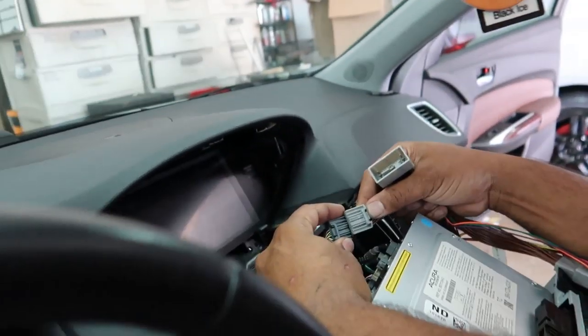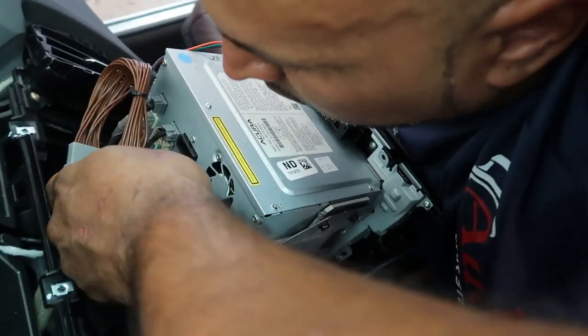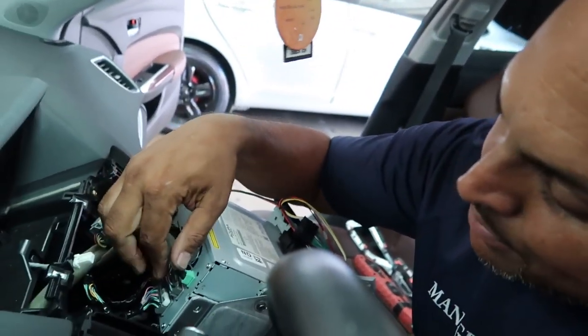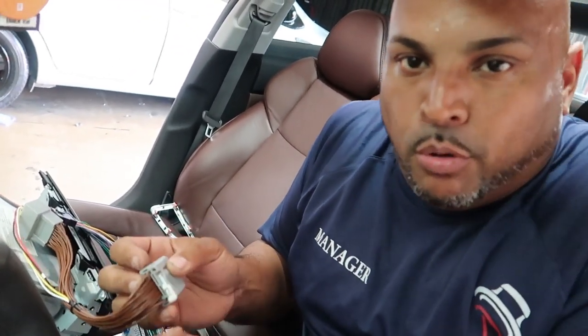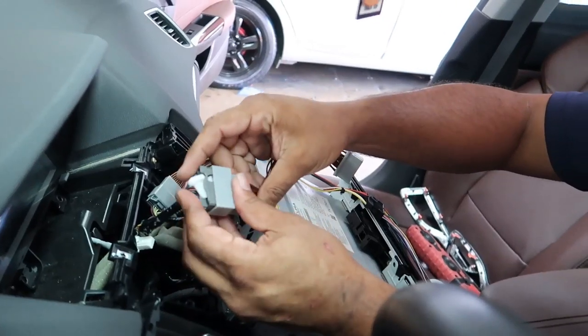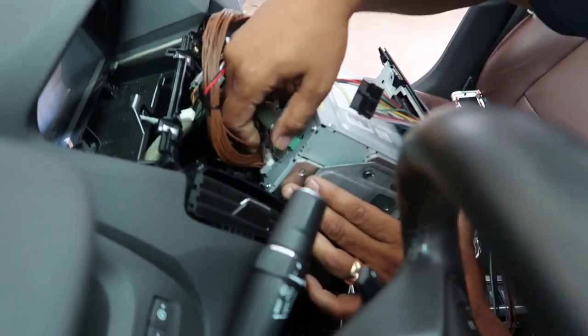You gotta find the perfect match. Now look at these two — I think we found a couple. So now we get the other T harness, plug it into one side, and plug the T into the other side. Now we're looking for the next plug — this one here you can tell it's the original Honda plug. This is one of the hardest cars to take the harness for the radio off — it's got this little swivel mount, and there's a little clip in the middle that has to be moved up for you to get the freedom in there. A lot of people like to pull and break them — guys, take your time, it's electronics, it's not metal, it's plastic.